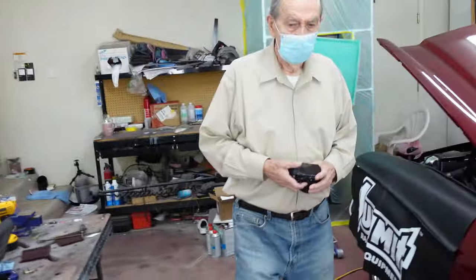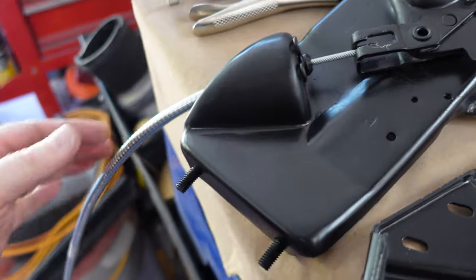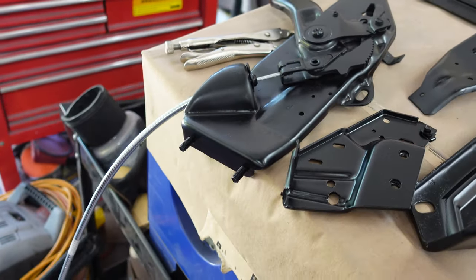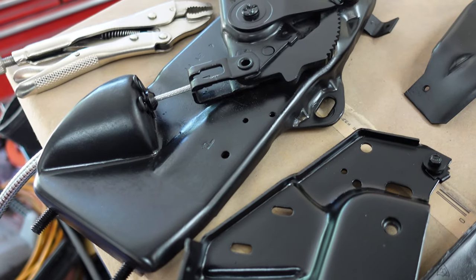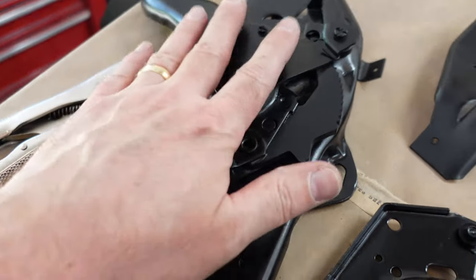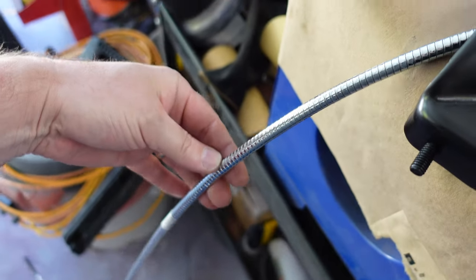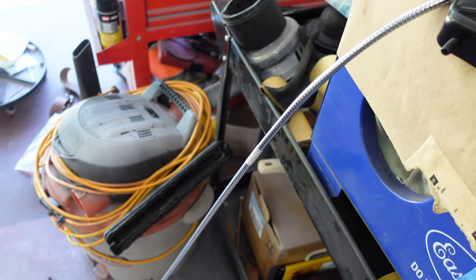The brake that you get is the parking brake. There you go — see how that worked? So we got a new parking brake cable for this thing, and we just got that mounted up there. It was a little tricky to do, but I put the vice grips right on the end of that thing, and while Pops was pushing down there, kind of dropped it in the slot there. So that's good to go. I don't know that we're going to fully mount this yet — I just need to get it kind of in the car so I can see where all this stuff ends up for the parking brake setup.